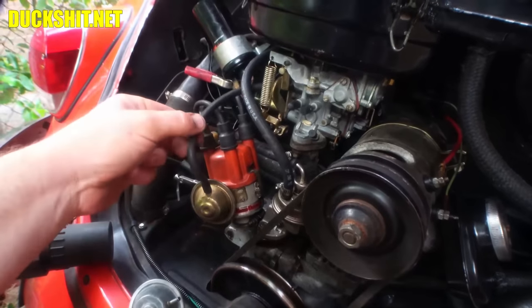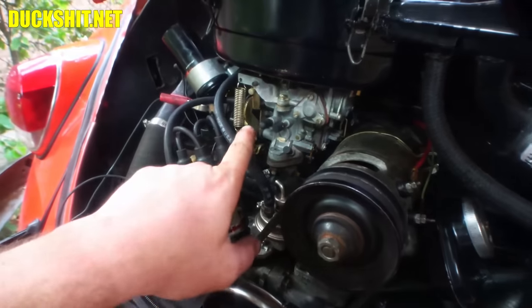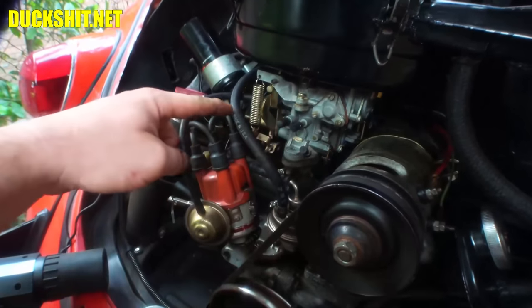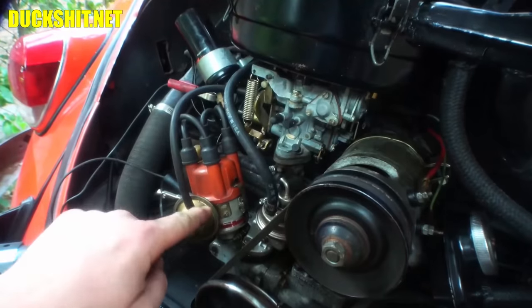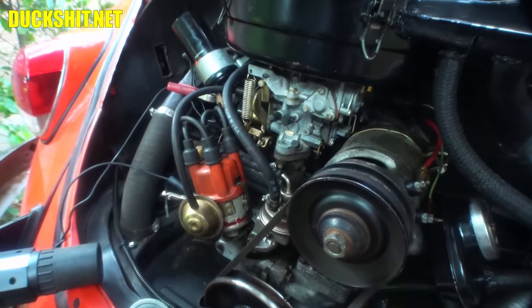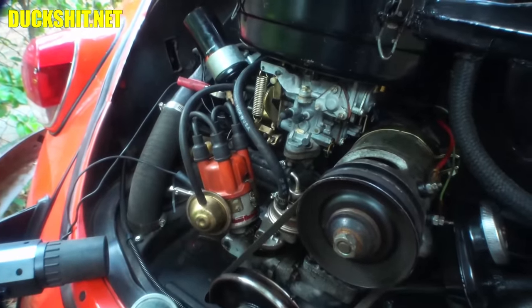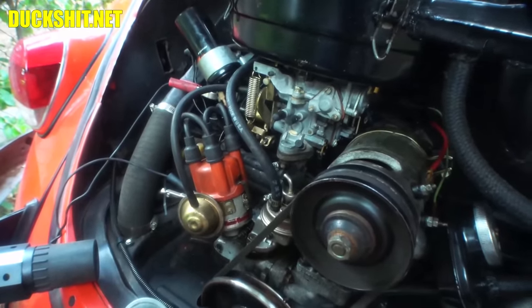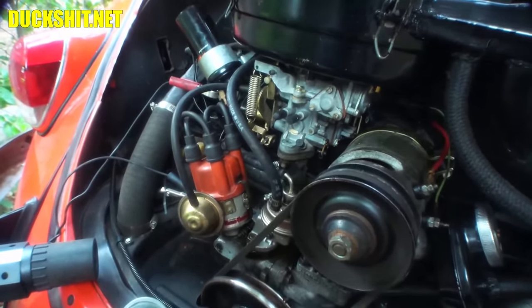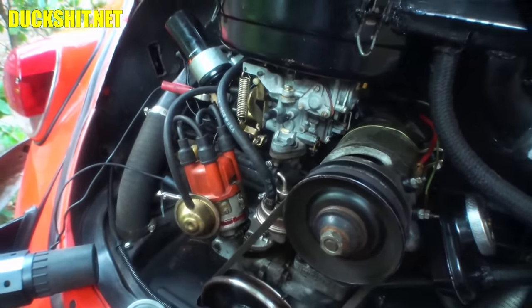You see this vacuum line? You notice how it comes from the carburetor and goes straight down? Well, any fuel that ends up in there could sometimes go down the line and it'll eat the little diaphragm inside the vacuum canister. So I think that's what happened, because when I went to suck on this thing to see if I got any advance, I got zero, nothing. And I couldn't get any vacuum at all on my tongue, and that means we're going to have a very bad day.